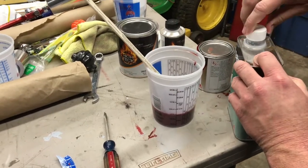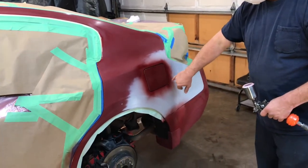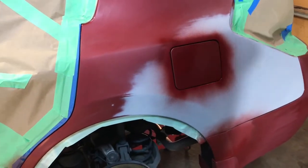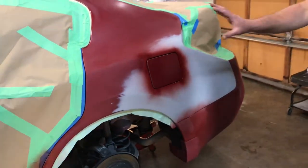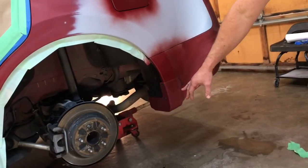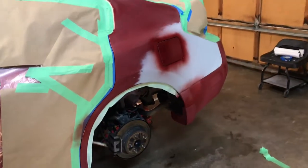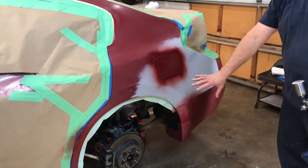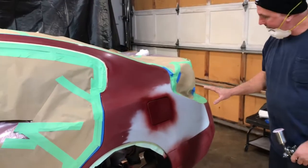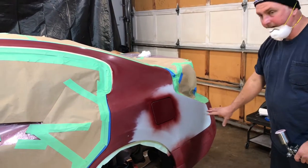We're ready to pour this into our base coat gun and go start shooting some base. What we've done so far: we went ahead and cut-shot some base coat on the inside edge of the gas door, hung it, and we've already shut it — two good coats, good coverage there. Now we're going to base this whole area down. I blew a little bit of base on the core and installed the mud flap. Right now I just want to get base on here — not really worried too much about breaking up metallic yet, just want to get two or three coats or however many it takes for full coverage.